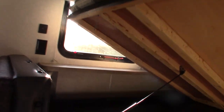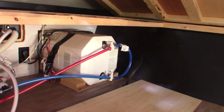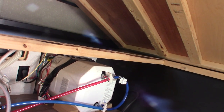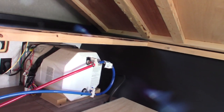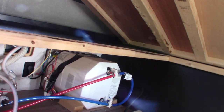These panels are left open so you can see where all the plumbing is and how you access it. If you look at the back of the water heater, it has a blue bypass line that you use during wintertime when you drain the water out and put antifreeze into the system but not into the water heater. With the handles pointing into the water heater like they are right now, it's set in normal camping position — cold water comes in on the blue side, heats up, and comes out the red side hot.